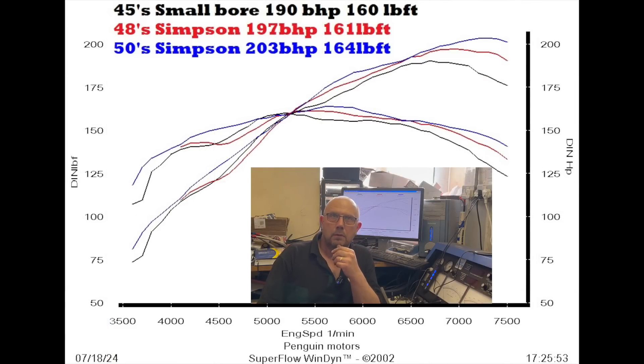It liked the 50s - better everywhere. That was a surprise. The only differences were that the 50s were on a different intake manifold, and I think that might have been slightly better shaped. The engine also responded to a slight change in ignition timing, but it was only slight - it ran around 30, maybe 31 degrees for all of them, so that's where the engine was happiest. It wasn't really in the timing, but there might have been a fraction in it.